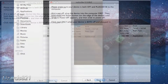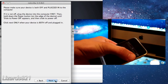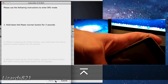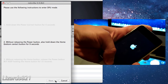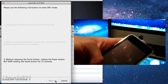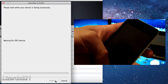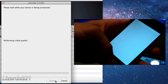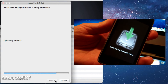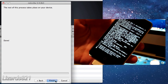Now we're going to put our device into DFU mode. Slide to power off your device by holding the Sleep button, then click Next once your device is powered off. Hold the Sleep button for three seconds, then hold the Home and Sleep button for ten seconds, then release the Sleep button and continue holding the Home button for about 15 seconds — usually it takes less. You'll see a white screen; release the Home button. You'll see a spinning disk image and code, and finally a running pineapple and the Apple logo.